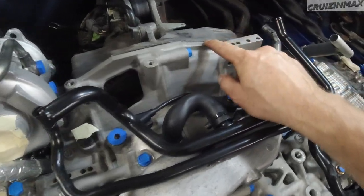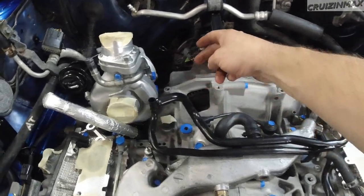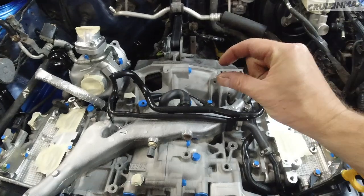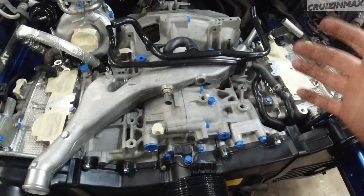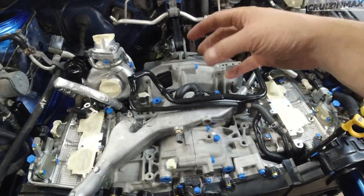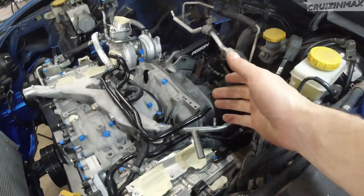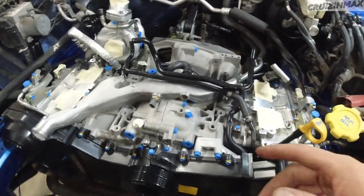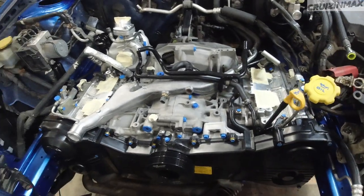Once it was in, it's got to be tightened obviously. I have one nut on one side and two bolts - one up here and one down there. Once you have this much space and can't push it in anymore, you want to be lined up block to trans, put in whichever bolt reaches, and slightly tighten them going back and forth. Don't tighten the two on top first - do one on the bottom and then one on top. That should be enough, and then it went in.